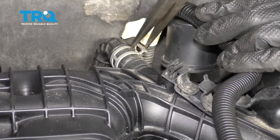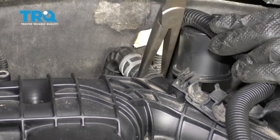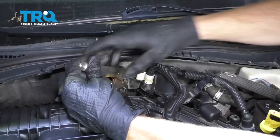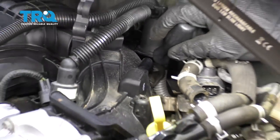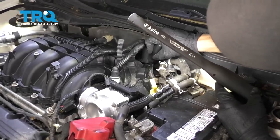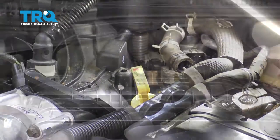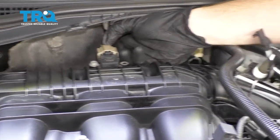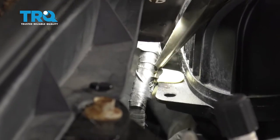The other line right here is actually a fuel line, and we're not going to bother opening that up. Grab onto this clamp, slide that up there, and remove this hose from the intake. Push that hose right off of there. Now right down behind this area, you're going to find a little clip — pop that off the intake and pull it out. Now we can come up along the backside of the intake and disconnect this, and get this off at the back of the intake.